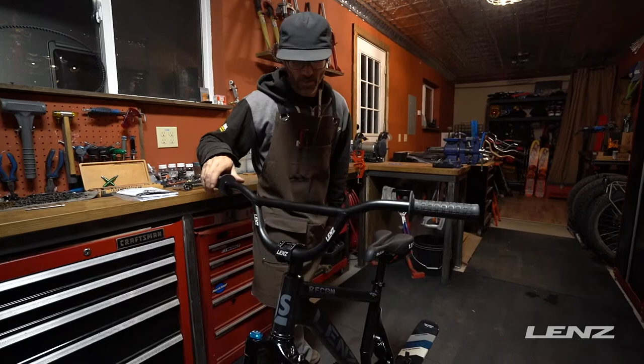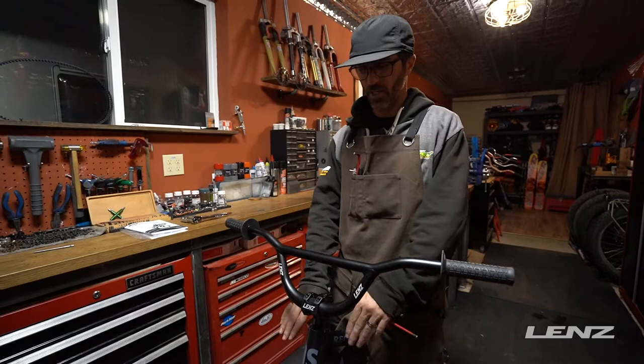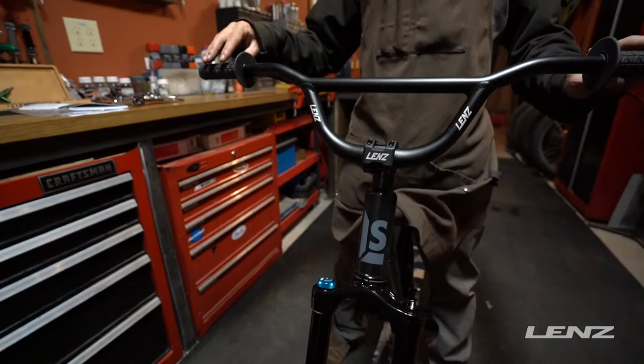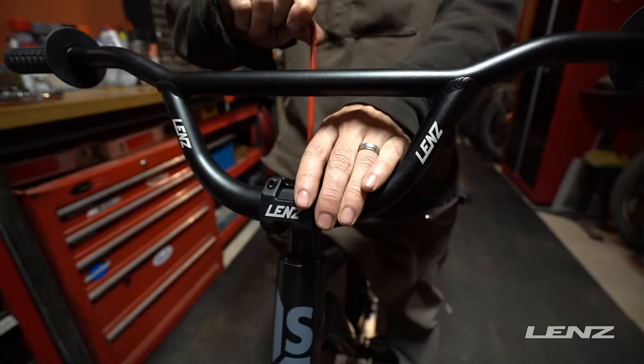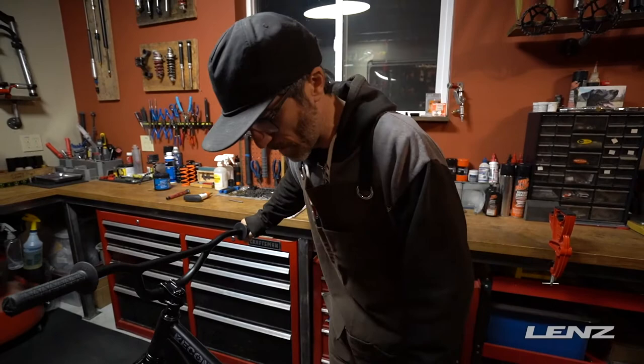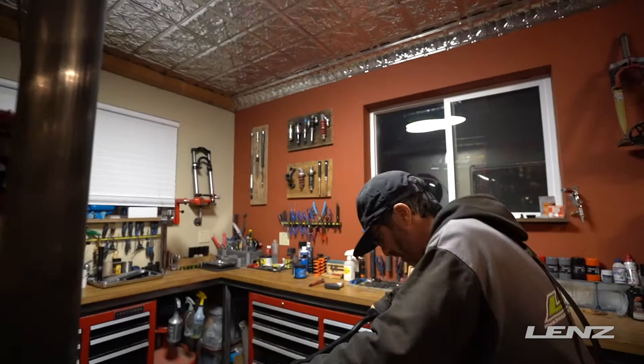Pop the bike out of the stand — we're in the home stretch. At this point I'm going to snug up the torsion arms here, which is going to hold this in place and keep the ski in the proper orientation. Now we get to stand over the bike for the first time. This is where we're going to try to center that handlebar and kind of look at the ski. Visually go down and sight the fork — I like to generally look at the crown of the fork and the bottom section of the handlebar, kind of tilt back and try to get a nice even gap looking down at the floor. We have our compression cap, which is the last step of our headset. When we tighten this down, we want that snug — we don't want to overload the bearing. Then we're on to the foot pegs. We have them where we can move them by hand, get that foot positioned to where I like, and they seem pretty even — grab my 8mm Allen key, hold that bolt in place, and snug this up.